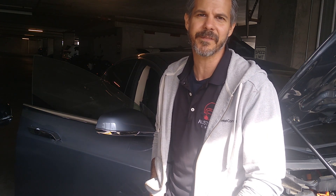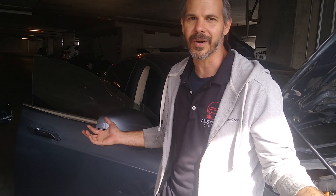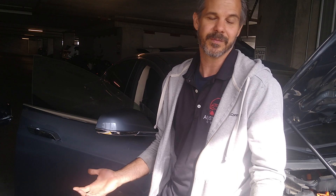What's going on, Austin EV-only family? Today we've got a Tesla Model S 85 — not the D, just two-wheel drive. We've got a bad body control module (BCM) and we're going to replace it and see if that clears up a lot of the issues this customer is having. The doors aren't opening, or when they're closed it says they're still open, the front won't open — a lot of little gremlins. The service center told him he needs a BCM. Unfortunately that part's super expensive, so we ordered one online at a severely discounted rate because it's used.